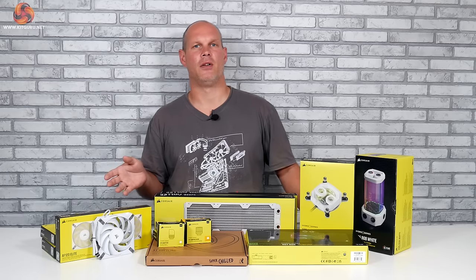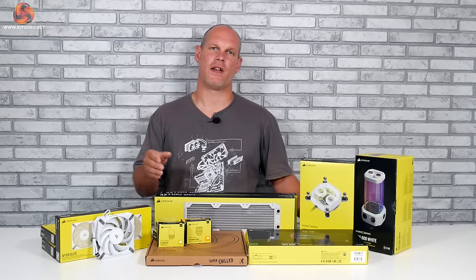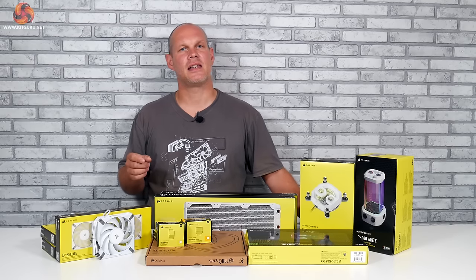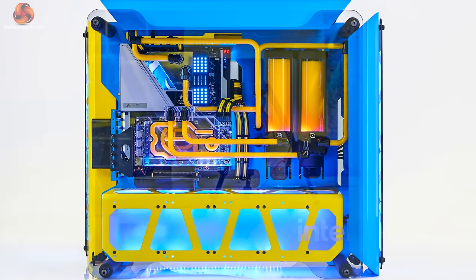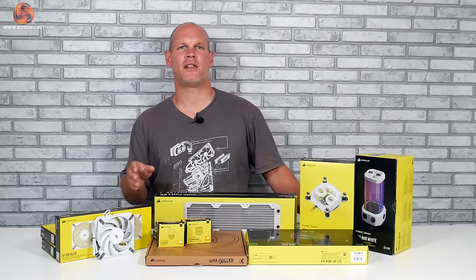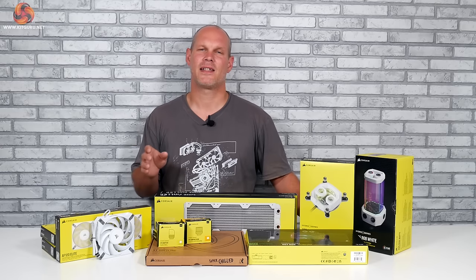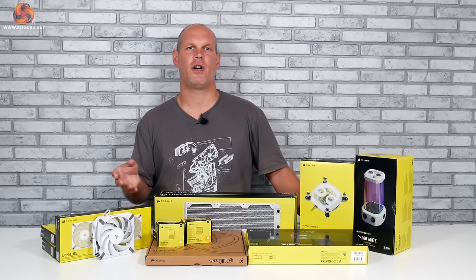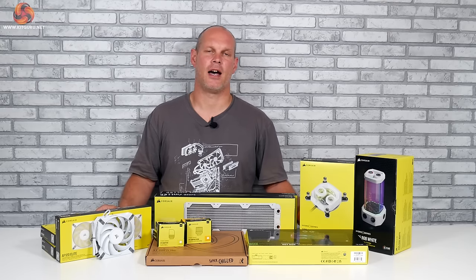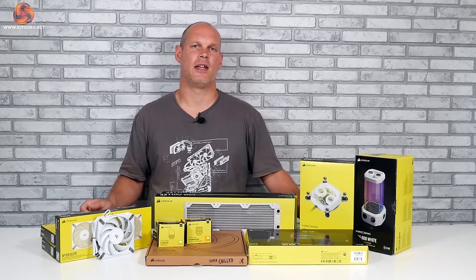This is especially true on hard loop builds when you need a spacer or an elbow to line things up. Soft tubing builds are so much more forgiving and quicker to put together than a hard line build — for some complex hard line bends it can take me just as long to get a single run bent as it would to tube up a complete soft tubing system. Soft tubing doesn't look quite as good as hard line builds, but for a more functional approach with relatively good looks, it is cheaper and easier to build and service.